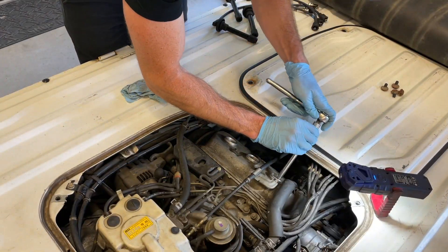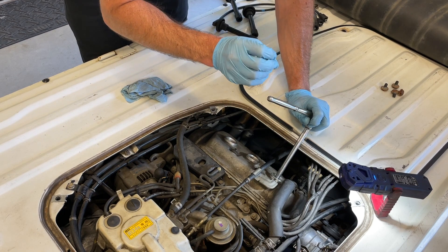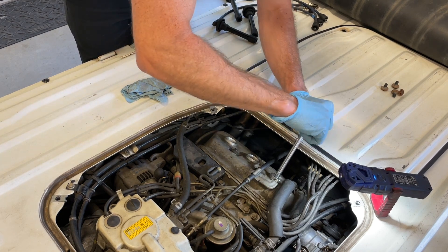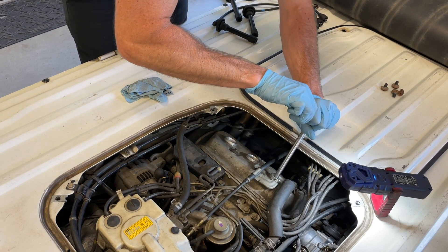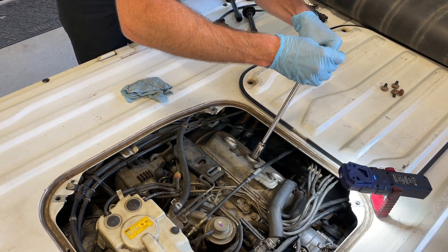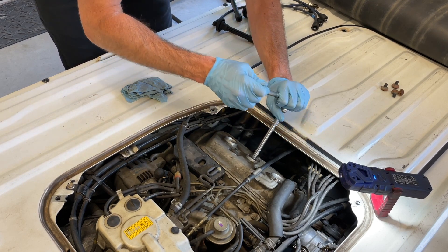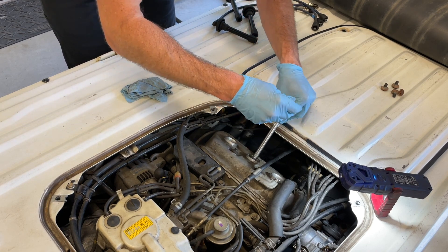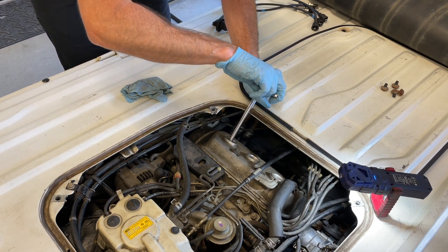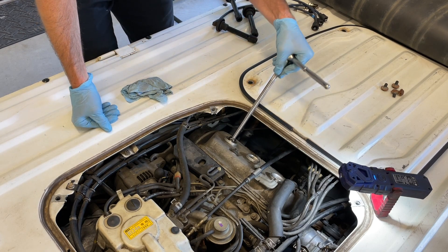So the kids have got all the spark plugs in, hand tight. I wish I had a torque value — I don't. You guys know I like my torque numbers. But keep in mind that new spark plugs have a crush washer on them. So as you go to tighten, you're going to feel it get really solid, and once it gets really solid you can almost feel just a slight crush, and then it gets tight again. So when it gets that tight again, stop — okay? We're not trying to rip the threads out of the head here. I've been doing this for a while, so it's almost like a mechanic's feel type deal. But you can feel the crush, you get a little resistance, and then it gets tight — and there it is. Same for all three. It gets a little stiff right there — you're crushing that crush washer on the plug — and then it tightens up again. And you know at that point you've crushed it and you're nice and tight.